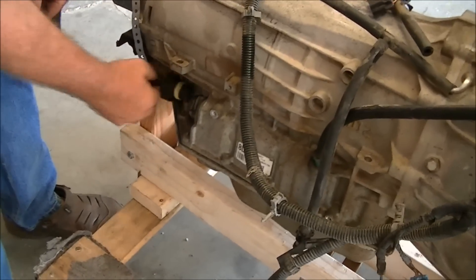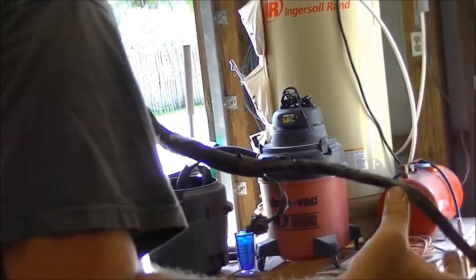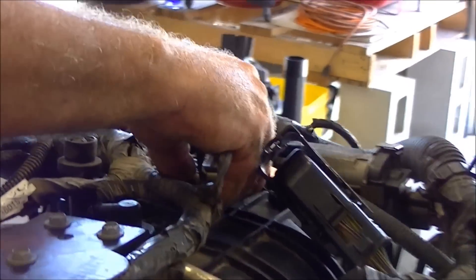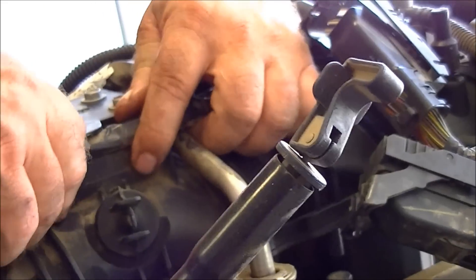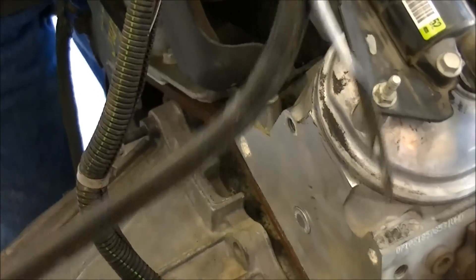Starting with the transmission — this one just lifts up and out, and that goes to the transmission TCU that's built into the transmission itself. This is the crankshaft sensor, and that just unclips. The thing about these trucks is every connector seems to be just a little bit different, so you just have to take your time as you work your way across your wiring harness and make sure you don't break these off. If you break these off, it's a real pain to replace them and you don't always get a good connection, which can lead to fault codes or electrical problems down the road. It's just a real slow process of taking everything apart, taking a good look at it, making sure it's in good shape.